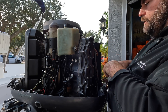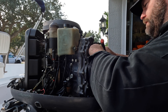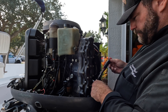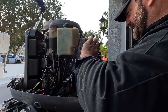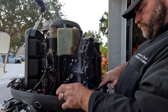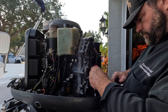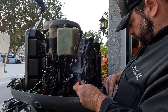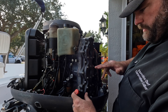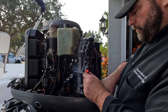Right here there's a temperature sensor - just make sure you disconnect it. It's usually just a couple of connectors that pop out and they're color coded. Make sure you don't pinch your wires when you put your head back together. Down in the bottom there are a bunch of head bolts - go one by one and don't miss any of them. There's one, two, three, four, five, six, seven, eight, nine, ten, eleven, twelve - there are fourteen bolts total, so make sure you've got them all.